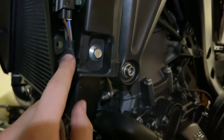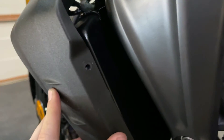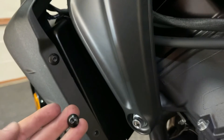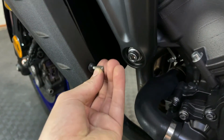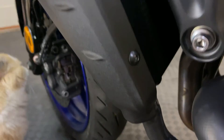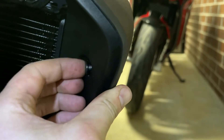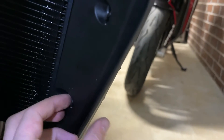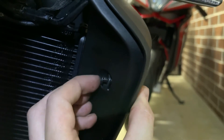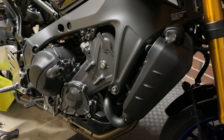Now place the cover back on, lining up the two holes, place the two allen bolts back in and using the H4 just tighten those up. With both those tightened, move on to the other side: without the centerpiece in, gently nestle the pushpins in, then grab the little centerpiece — you can just clip them into place, nice and snug. Same with the second one. We're now onto the final stages.